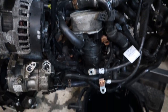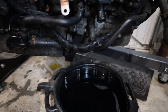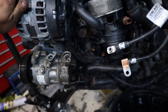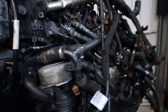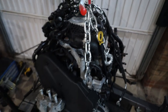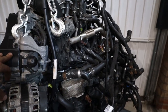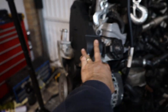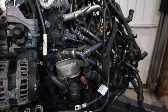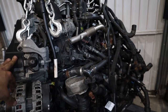So now this is out, I can just give you a little bit more detail of why we did it. The van actually has an oil leak from underneath - it seems like there's a little crack in the sump so we'll have to get another sump for it. There's various electrical connectors to fix. I thought with the rain in Yorkshire it's probably better that we bring it in here, get everything sorted like these little clips. We'll probably pop all that in the next bit as well, just to show you all the repairs we do to the engine, put the other belts on. We can check for any other damage, and I would paint it but I can't be bothered to take all the hoses off, so we'll probably just give it a clean up as well.